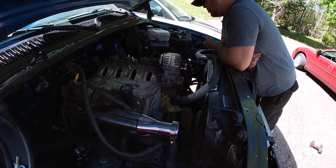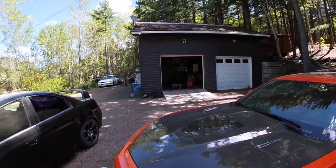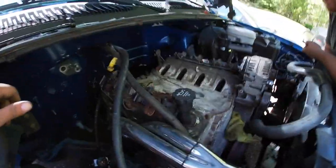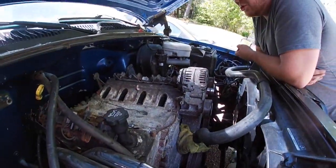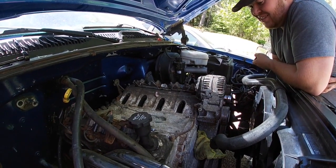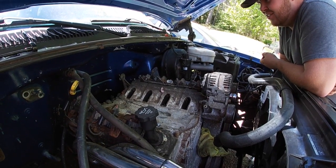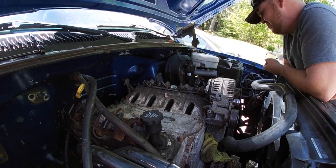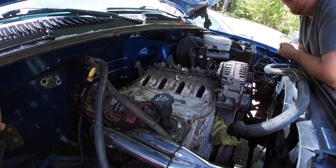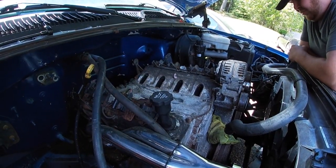And as you see, we're doing it in the driveway. Unfortunately, there's a PT on the hoist. So as you see, it's literally driveway built. So I think we're going to need to break out the shop vac before we take these off, so we're not getting too much mess down inside. We've got to take the manifolds off. Alternator. You need to take that alternator bracket right off. Yeah, because that bolts right to the head. And then we'll get the shop vac out.